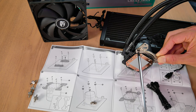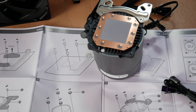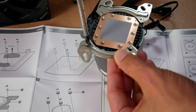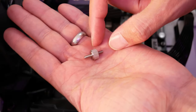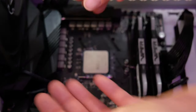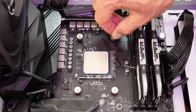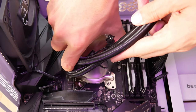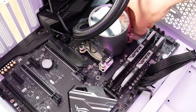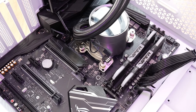It always helps to have a magnetic screwdriver if you have one handy — otherwise you'll just need maybe three hands to get this done. Once I have these in place, I can go ahead and mount it to my motherboard. Note that you will be using the AMD backplate that comes with your motherboard, and you'll be using these thumb screws to attach it. Note they do have a different size of thread — the thicker thread goes into that backplate. Don't be alarmed when you're done if the backplate seems to float; that is part of the design of the DeepCool cooler. I carefully lower the cooling block into position, remembering that there is thermal paste applied to the bottom of it, and then use the other thumb screws to attach it diagonally from side to side to equalize the pressure.